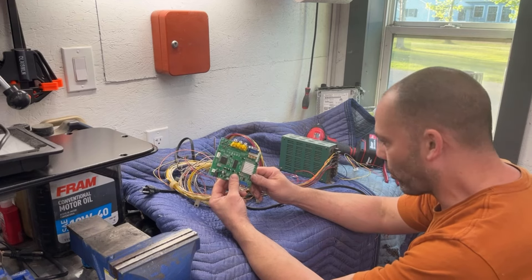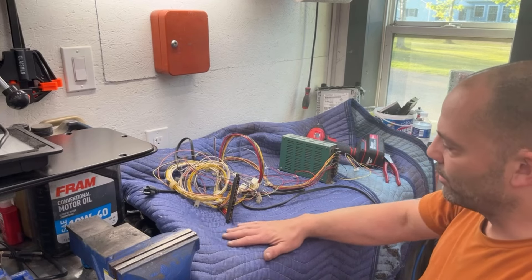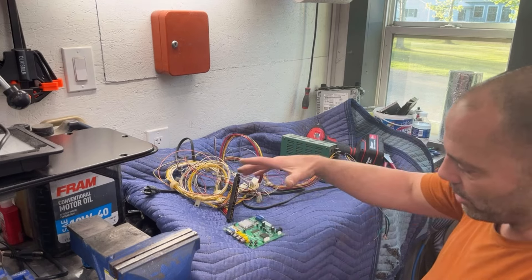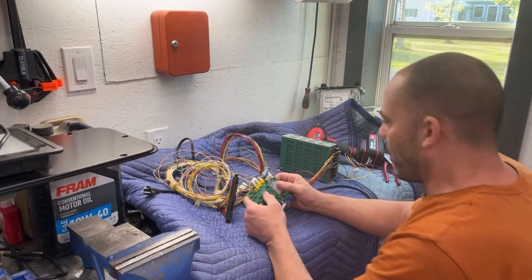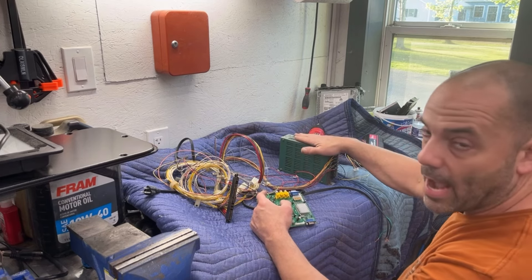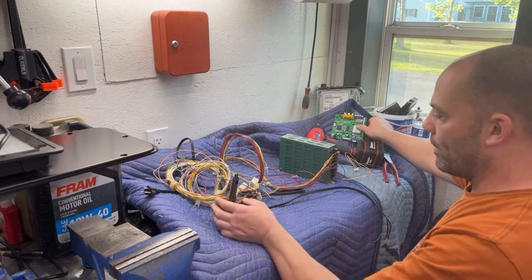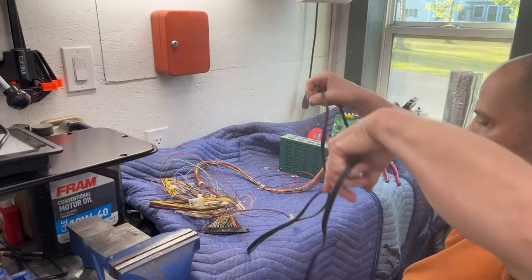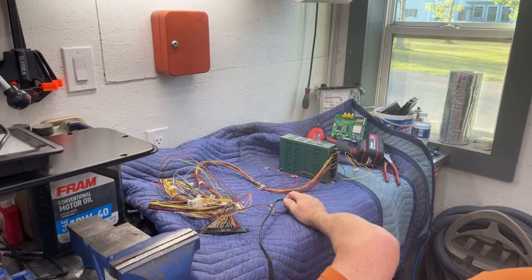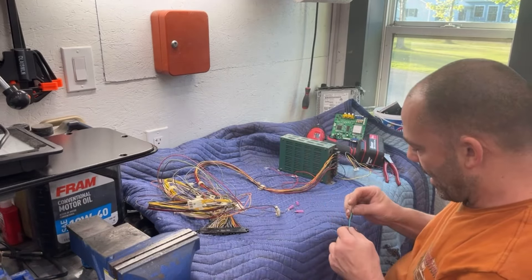It is an original Tetris circuit board. I stuck this moving blanket on the metal table because you obviously don't want your circuit board laying on metal — you're going to short it out. First thing I want to do is get the power on and check our voltages before we plug anything in. There's a power cord that came with it, and I need to put these crimp end fittings on with the shrink tube.